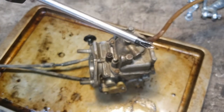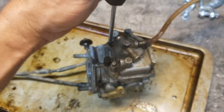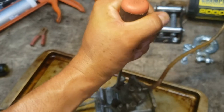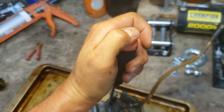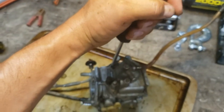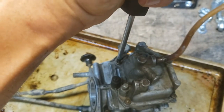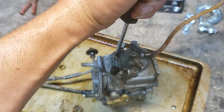It's not too terribly bad. And you get it down in there and seat it as best you can. Put whatever it is that you're working on onto a solid surface, and then as you're trying to loosen that, just apply a little bit of pressure and rap on the handle up here with a hammer. Gently. You're not trying to kill it, but the impact and the force driving the tip of the screwdriver down into the screw will many times allow you to loosen the screw.